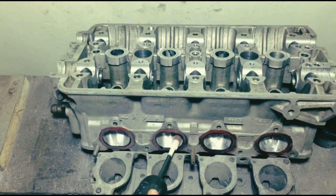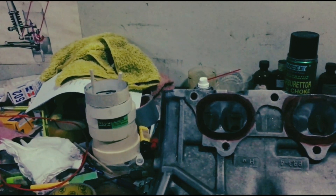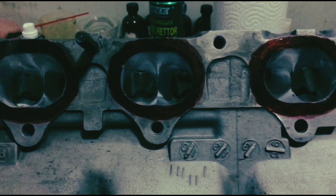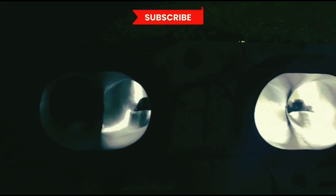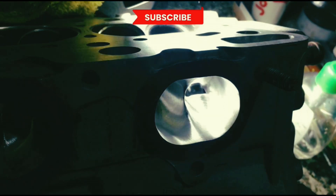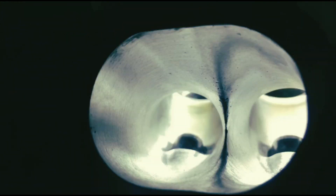Now onto the floor — you can see it's getting better and better. Here we are looking at the finished exhaust ports — really smooth, achieving the shape and contours we like. For a better visual we're using light, as you can see all the curves are really consistent. The light helps us see unevenness or unusual bumps not visible without it. You can imagine this is going to flow really, really well — the exhaust ports are looking great.